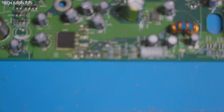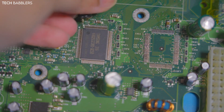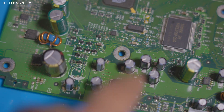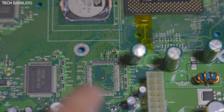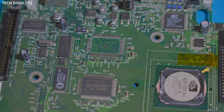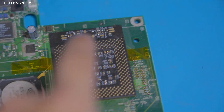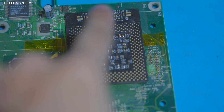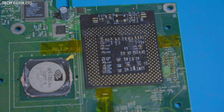Also, this is the clock cap. For anyone that knows about the Xbox, it usually goes bad. This is how it looked on this console, so I removed it, cleaned everything up with some IPA — that's good to go. Everything else looks good. If we get this going, I'll probably also put on four RAM chips — two on top, two on bottom — and we'll have 128MB. It took me almost an hour just to do this part with the resistors and capacitors, and probably another hour to solder it back on. It's definitely a process.